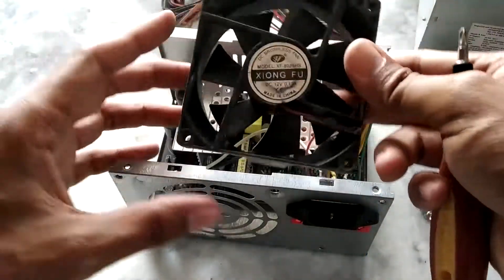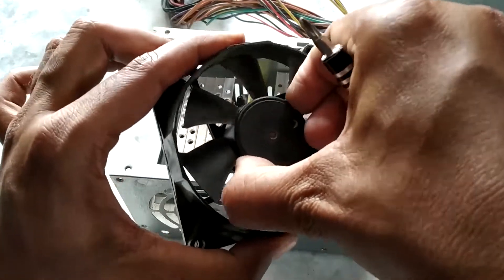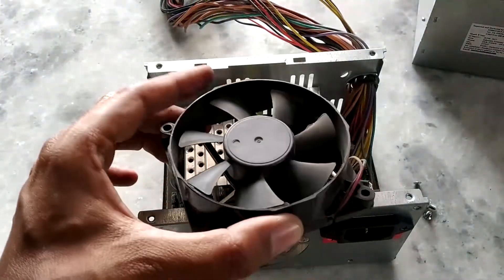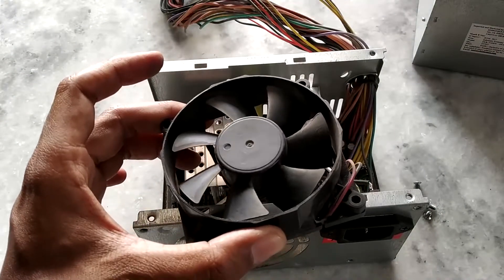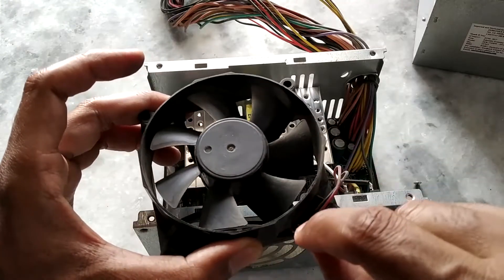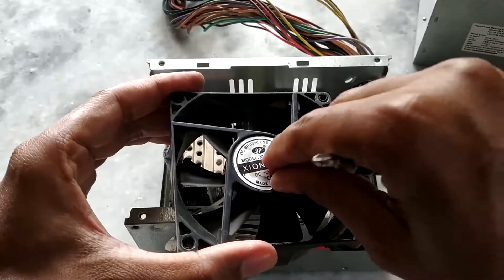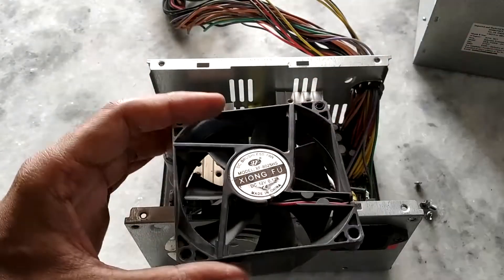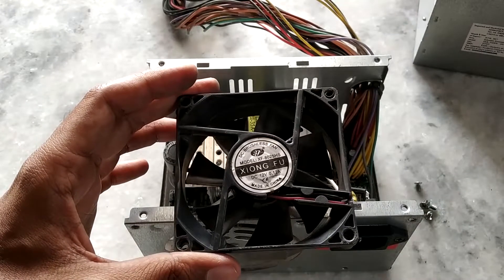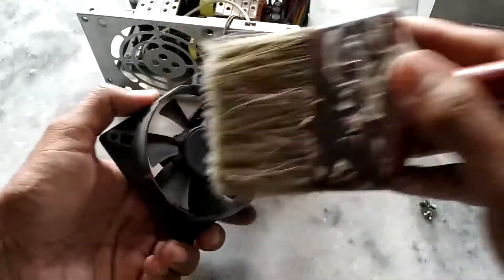You can see the fan is now out. It is not rotating — I'm not sure what is stopping it. I think we need to re-lubricate it because by appearance it doesn't look that dusty. Let me open the cover up, clean it a little bit, and put some new lubrication in. To re-lubricate it, simply take this cover out. But before you do that, remove the dust from the top using a paint brush. Let me clean the fan as much as I can.